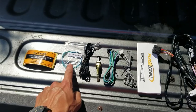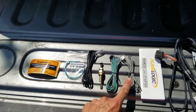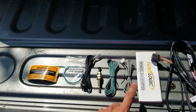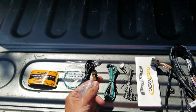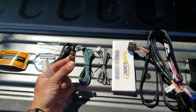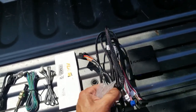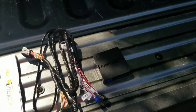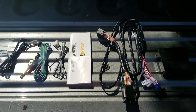Now this is everything you're going to get in the kit. You've got some optional wiring harnesses for some additional things — not required for the installation, but if you want your horn to beep, your parking lights to flash, and the safety of making sure your hood's not opened during the start sequence, you've got this hood pin sensor you can install as well. This is your main T-harness, which goes in line with your ignition wire. And here's the actual control module that handles the additional programming required to get the remote start system to work.